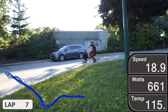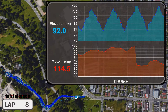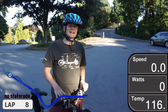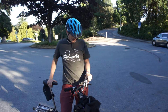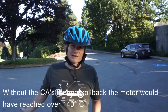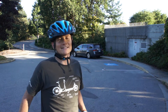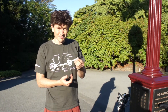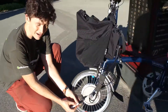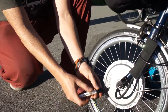After one last run, that's the steady-state temperature with the Cycle Analyst now limiting my maximum power to keep it from getting too hot — limiting me to about 600 watts. Right up until then I had 800 watts during the entire ascent, and the temperature kept increasing until the Cycle Analyst kicked in. So what I'm going to do now is put about 3.5 milliliters of statorade into the motor. There's an injection port on these motors — since they don't have a disc rotor, there's a little threaded hole right in the middle of the axle for Crystalyte.